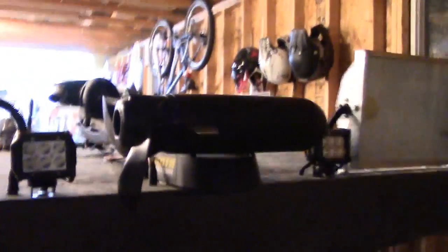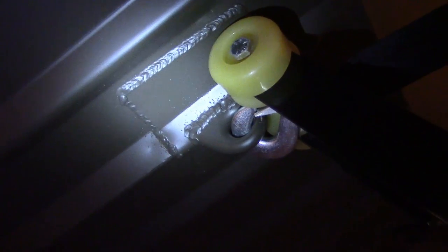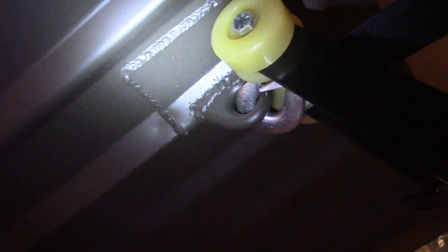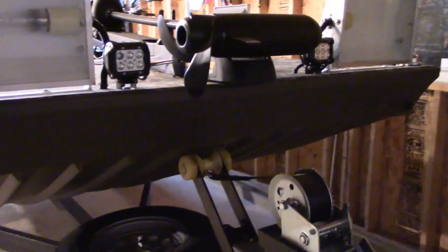Notice that steel plate welded on there — it goes right to that eye bolt on the bottom. I had them reinforce the bow eye when they built this boat. There's a thick aluminum plate on the outside and one on the inside that sandwiches the boat, all welded together for reinforced strength. That way, when I'm hauling that boat up on the trailer with all that weight, the bow eye is going to hold together without cracking.